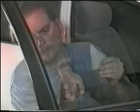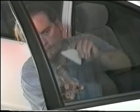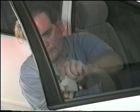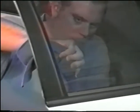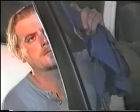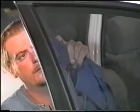If any fingers should arise, gently stretch the film away from the finger. Push fingers toward the corners, not toward the center. To complete the window, dry blot all vertical edges and the bottom door rubber. Do this to ensure that no fingers will come back later from moisture at the edges of the film.